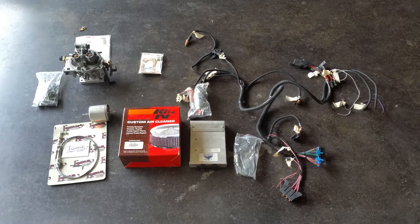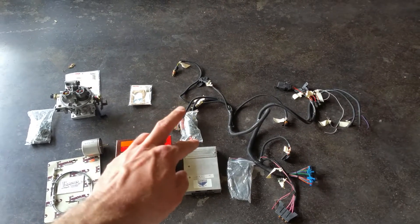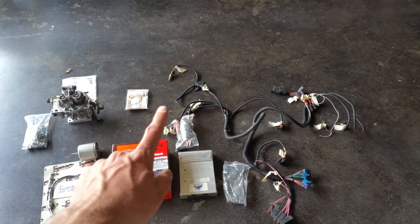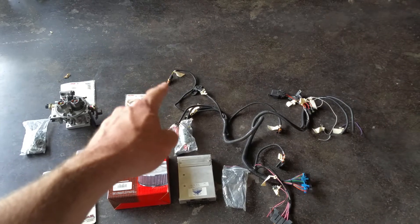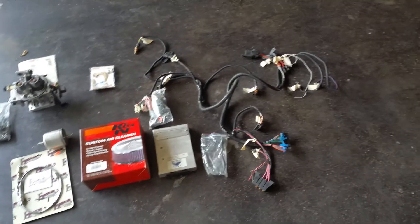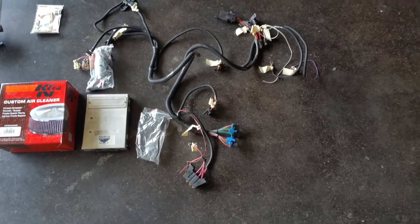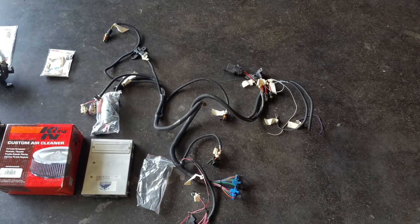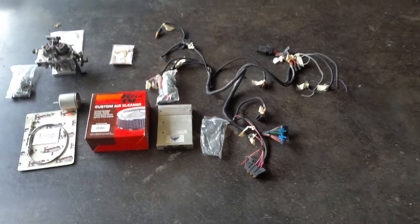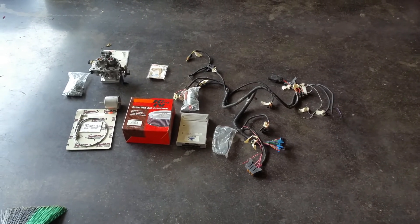Anyway, I hope this was informative for you guys. Really, you just have a few sensors: throttle position, MAP sensor, stepper idle control, coolant temp sensor. On the Megasquirt you also need an inlet air temp sensor, which is honestly almost the same exact sensor as the coolant temp, and an O2 sensor — and that's pretty much it. There's a lot of information on this and how to wire it on the DIY Auto-Tune website, where you can find all the wiring diagrams. It's super simple — it might look complex, but it's almost as easy as wiring a stereo. Hopefully that helps someone out and you guys can get fuel injected on your older Toyota Land Cruisers. Thanks for watching.